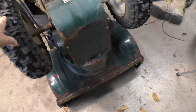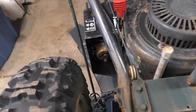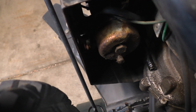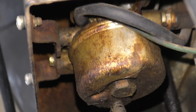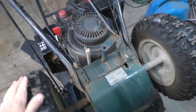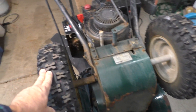Normally what we would do is work on the carburetor. Here's a good shot of the carburetor right there — look how gummy that is. Wow, what a mess. We are not messing with this. This is a non-runner. Won't run unless you put it on full choke, and even with full choke it surges. I got a new carburetor, so I'm not even going to deal with it, because that's a mess.